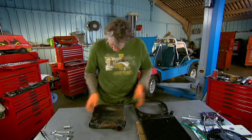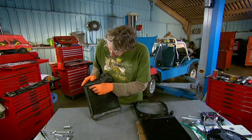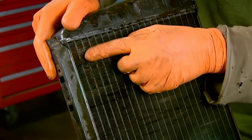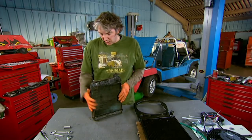If I have a look at the radiator — there's a hole that's been filled in, either with the sort of stuff that was in the water, or perhaps with some kind of chemical metal. So, obviously, if it's got a leak there and they've had a few issues, I think the best thing to do is just to get rid of this standard radiator.